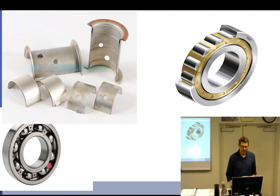These two are our anti-friction type; these are plain. That gold part is the thrust. That little bulge is the tang. Why is there a hole in it? That's where the oil comes through. There's a hole in the middle for the dowel. When putting these into the crankcase, you have to make sure the oil holes line up — you don't want to cover an oil hole.